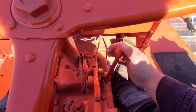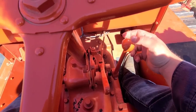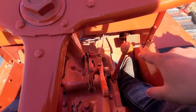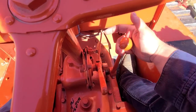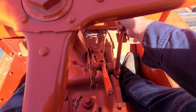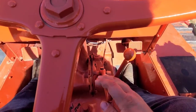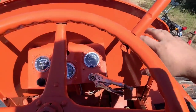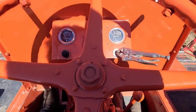The way this works, you actually pull in and out on it. It's a little different. It will return to the neutral position — it's just in H pattern. To get to the left side of the H, you'd push in. To get to the right side, you would pull out. And then, once you're out, you can push up or pull down, depending on what gear you would like. Throttle's right here — it's a little different. My other K, it's up here, but I suppose, with the steering wheel, they didn't want that interference.